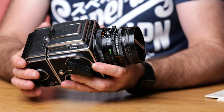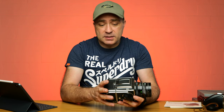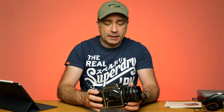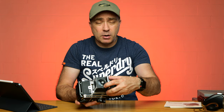So the back goes back on and I put the waist level viewfinder back on. You'll see a lot of people just bash the backs together — don't do that. You pull the pin and lock it in gently. Do not bash them because you'll bend something and damage the seal around it. You just flick the switch and close it up. Inside the viewfinder there's a little switch and a magnifier that comes up, which is quite handy.